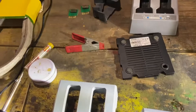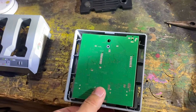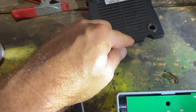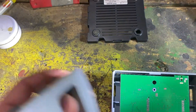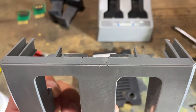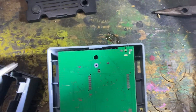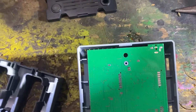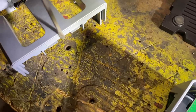So those will come out. This will come unplugged. To get it unplugged, you've got to slide a screwdriver right here at these tabs and they'll come out pretty easy. But the back of this, how it sits, has a double tab that you can't get to. So the only way I know to get to is through this one hole that the board's connected through. You'll slide a small flathead screwdriver and it will pop that out when you twist it.